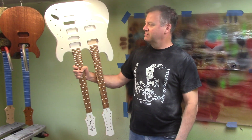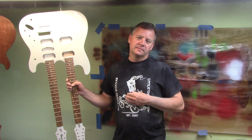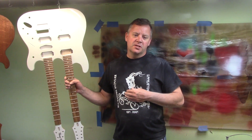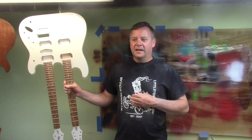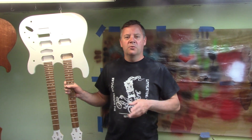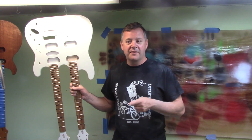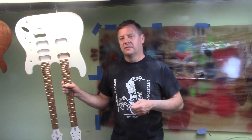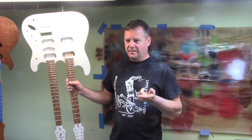It seems like it was really easy, but it took a lot of time. We don't spray nitrocellulose lacquer anymore. We use an acrylic enamel base coat with a urethane top coat. My favorite advantage is that you can get literally any color that you want — metallics, solids, candies, literally any color. If you've ever seen a car in that color, or even if you haven't, you can get any color you want. The urethane top coat is a little more durable, it goes on in fewer coats, it doesn't yellow over time, it doesn't age over time.